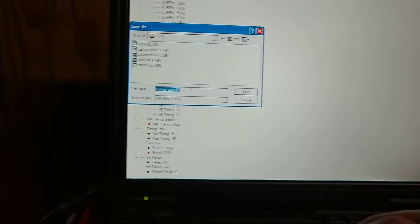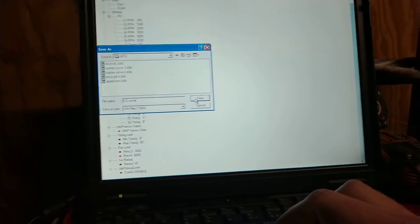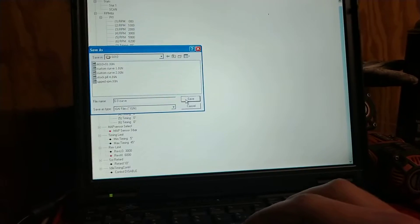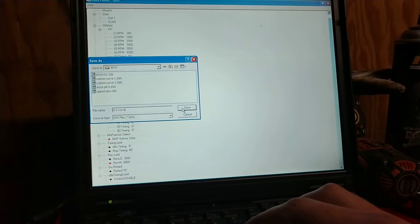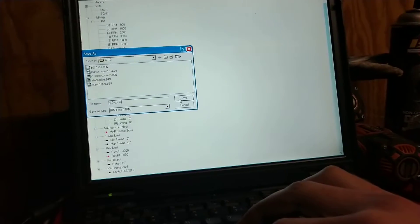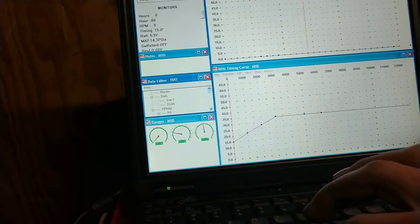Now we're going to do custom curve. Your ignition curve — a lot of you guys know and a lot of you guys don't know — there are so many variables to determine which is the best curve you're going to need. The operating conditions when the engine is on the dyno are way different from the real world when it's in the car, in 100-degree traffic, when the car weighs 4,000 pounds, etc. So it's plug and play, and that's what's nice about the laptop. I'm going to save it as a 2-bar and then go back — I already saved all my settings and I'm just going to transfer all this information.